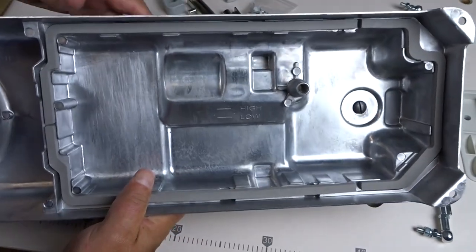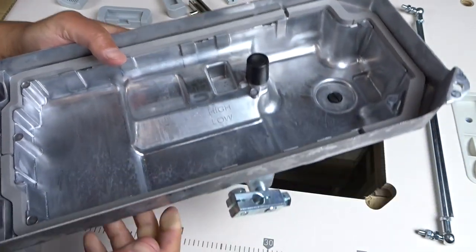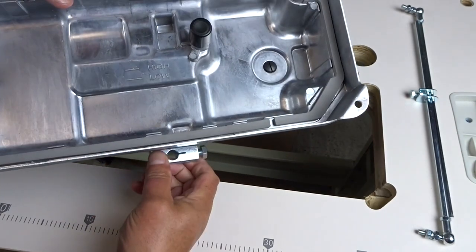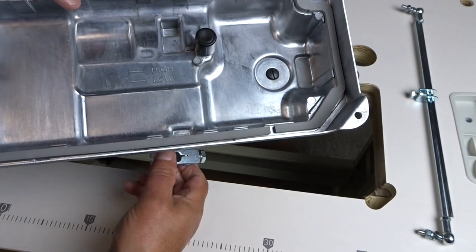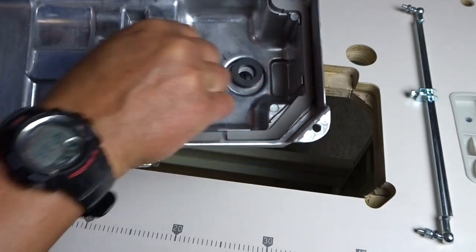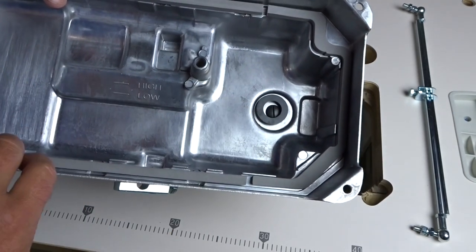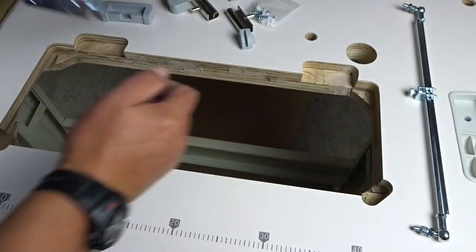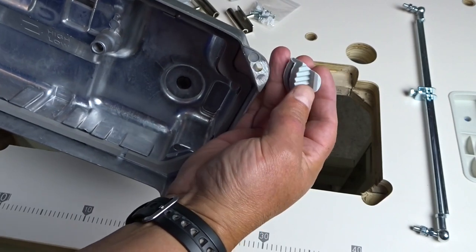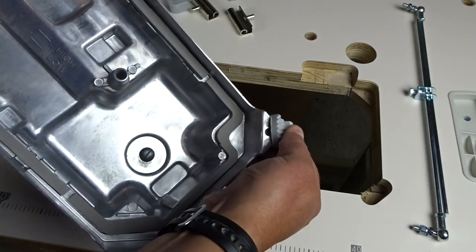There's the oil sump there. There's a hole here for this here to go down through, and then the knee lever attaches to this here and pushes up this here to lift the presser foot. And we've got this magnet here that sits down and catches any, you know, very fine metal or pins and things like that. The sump itself sits down in here, but first of all these rubber corner pieces here, so these here just sit in like that.